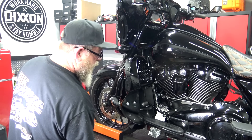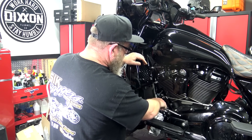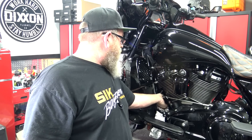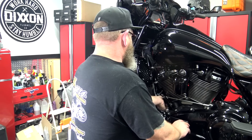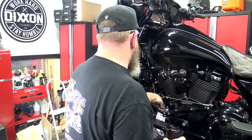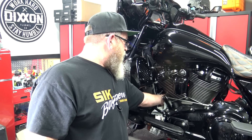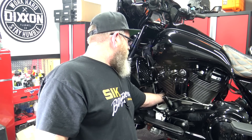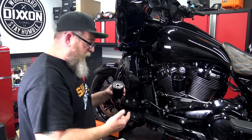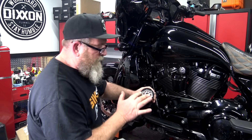Now that I've got it loose, we're back on track. I'll pull it over — you can use the foil to catch drips. We're going to turn this and pull it out, then mop up what's left with a towel. You need to clean that area up anyway so get in there with an old towel. Now that we have the oil filter out and that area cleaned up, take your rag and clean up that edge.